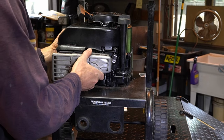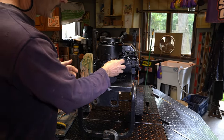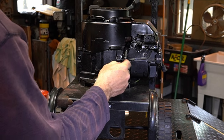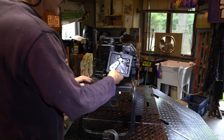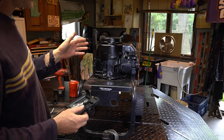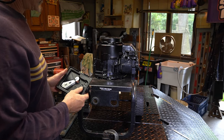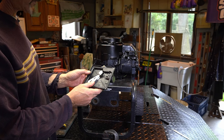The next thing I'm going to do is turn the motor around and mount the carburetor. This is where I found the PCV vent - it was twisted and collapsed, pushed over and distorted. When I went to take it off, it was mashed into place. It wasn't connected, so it was just venting the combustion gases from inside the motor all over the place behind it. If it was burning oil, you'd get blowby and that oil smoke would be sucked back into the motor and expelled out the exhaust. But with it dumping behind, it was just dumping to atmosphere and not being recycled.